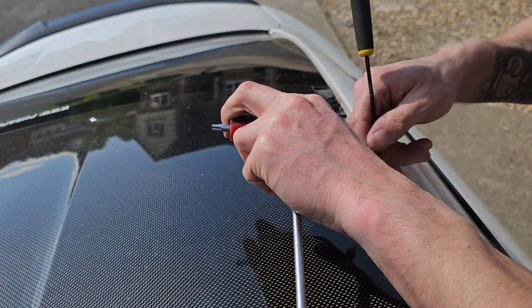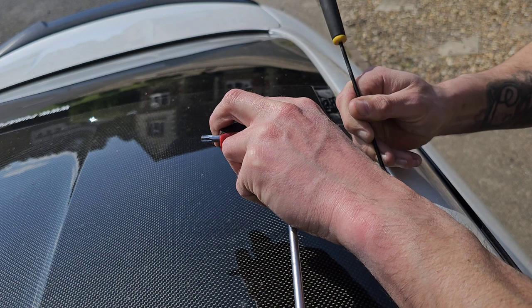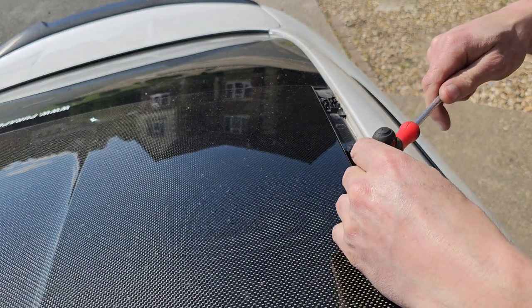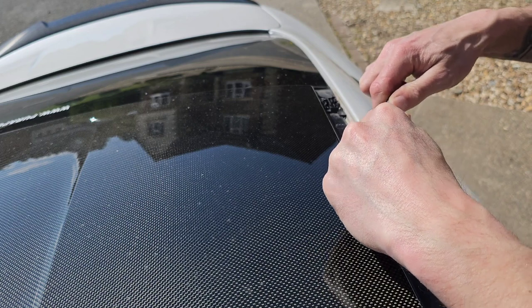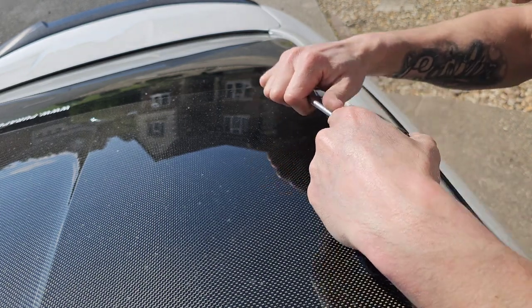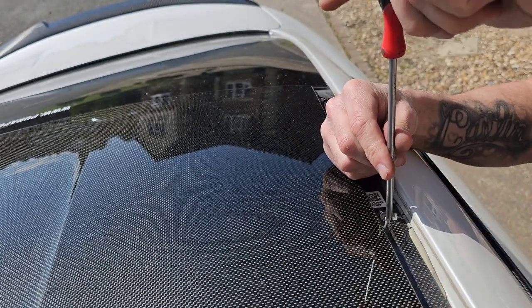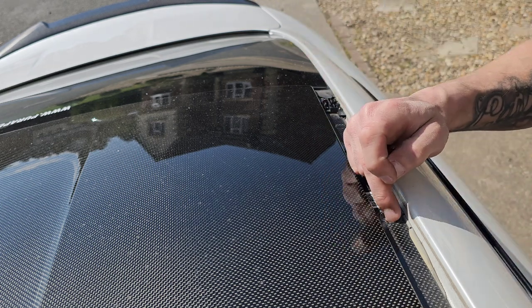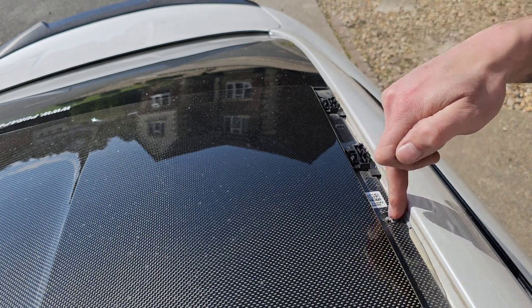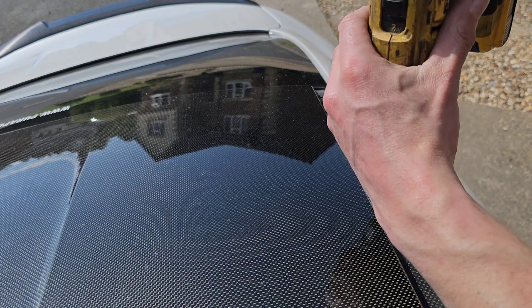There's a lot of bits of crap out of the Torx hole now. There's a bit of a strain to break her free - I imagine there's some kind of sealant on there. I can see that it's still catching the edge of the carbon just a little bit. What I don't want to do is thread the screw up and lift the carbon and crack it. I would rather spend the extra time just getting that where it needs to be.